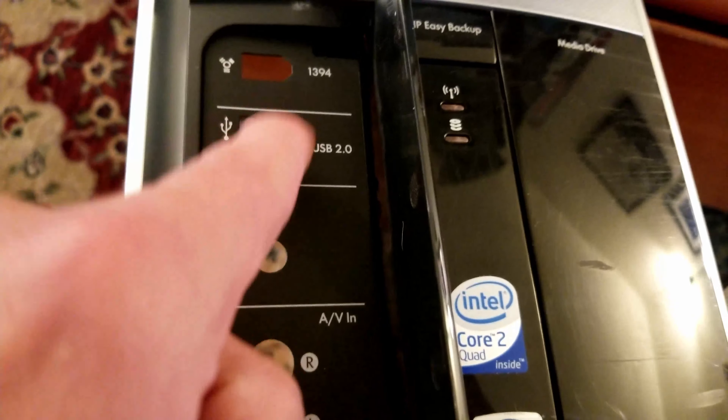I've got the TV tuner card installed where the fax modem was, and I put in a PCI Express x1 dual-port FireWire card just as a slot filler. The fan's clean. I've got the Q9400 installed with thermal paste repasted and fan cleaned. I'm doing my best at cable management here. I still have to put in the drive cage and the drives — I need to get all these USB cables and expansion cables routed correctly, including the wireless antenna, USB to the front, and USB to the back.